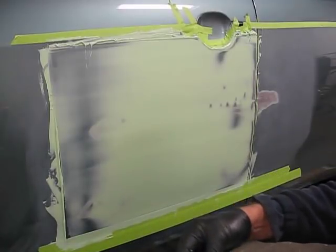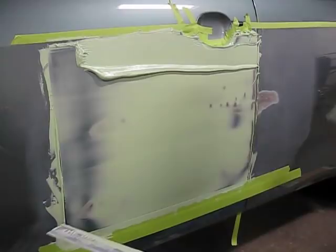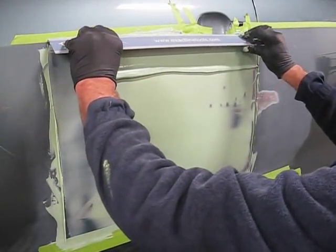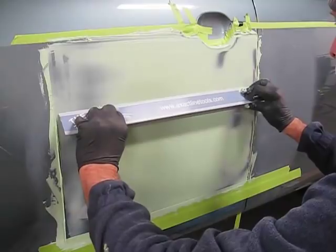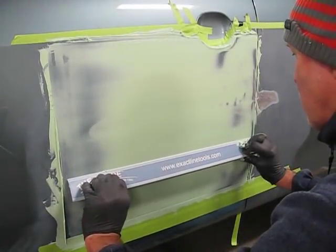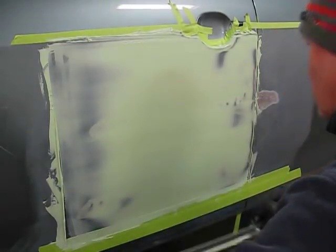You can see that we have, once again, I'm removing it and placing that Bondo at the top of the sweep, and I will continue to move down it until I get a sweep that I like. You can see the Bondo being blended, moved, and arranged in such a way where it is taking the shape of the adjacent areas that are undamaged.